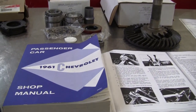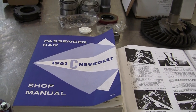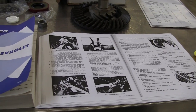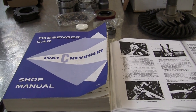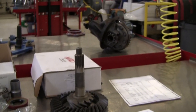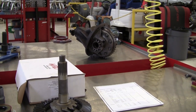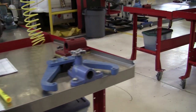The owner of the vehicle, Mr. Fultz, has given us a 1961 Chevrolet manual to use, which I've photocopied pages from so I can write on them and get them dirty. Apparently this differential style was used from the early 50s up through about 1965, and then after that they went to the non-removable differential housing where you have to remove the complete differential case with the ring gear by itself rather than the entire housing.